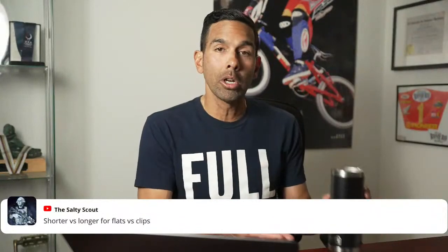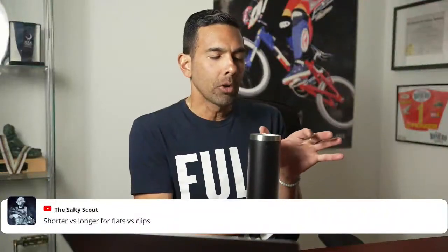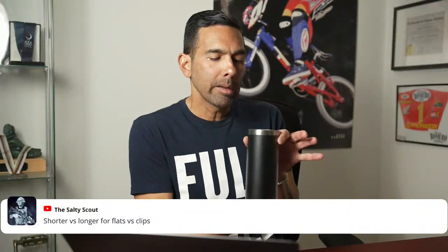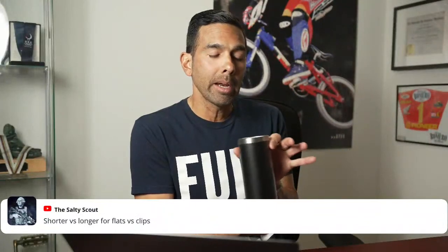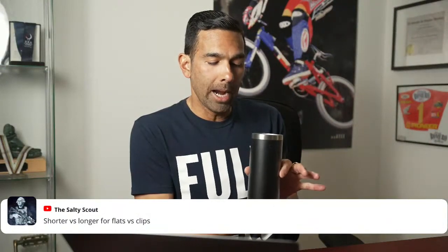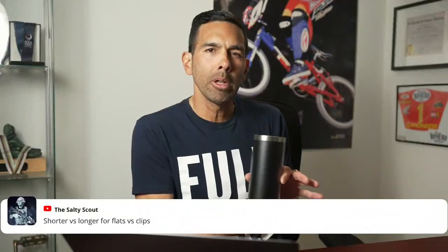Again, we talked about it earlier, the concept that Billy, my bike designer at GT, who's now the bike designer at Chase, explained about bottom bracket heights. If you grab a can at the top and it's sitting on a table and you go side to side, you have a lot of leverage. It's easy for that bike to go side to side. If you were to lower the bottom bracket, grab the can at mid or lower and go side to side, you'll notice that it's really, really stiff. It's hard to go side to side. So therefore, you're spending a lot more energy going forward.